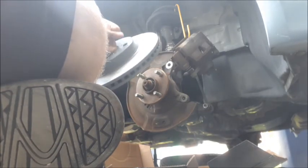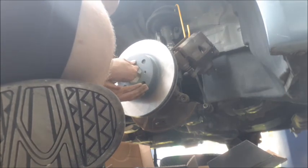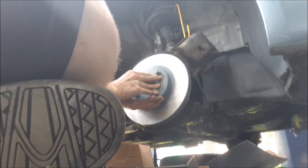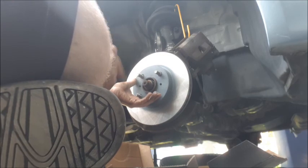Be careful to avoid touching the surface of the rotor that you have just cleaned. Grab a lug nut and secure it there. So while you have the caliper bracket off, good idea to take off the old clips and then just clean the mounting surface — look at all that brake dust. Get it nice and clean. Grab your new clips and start throwing these guys on there.